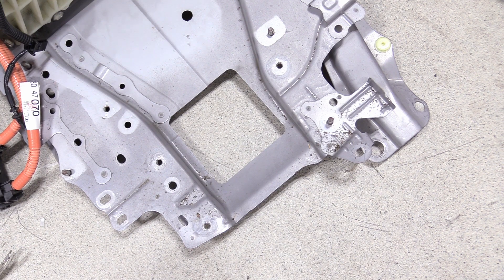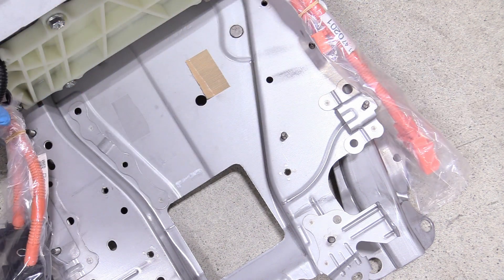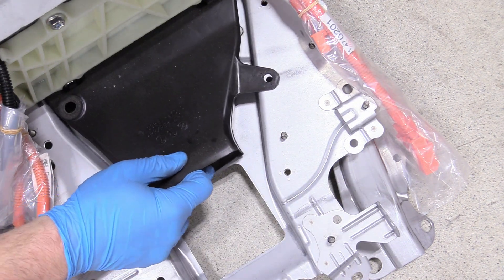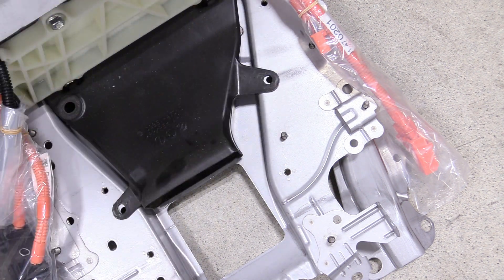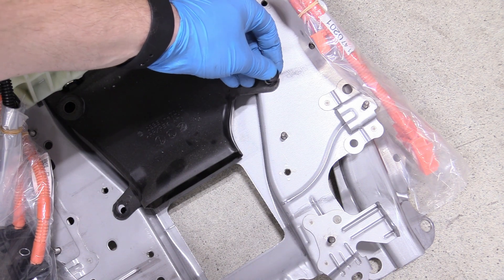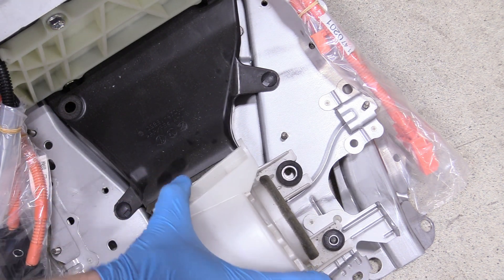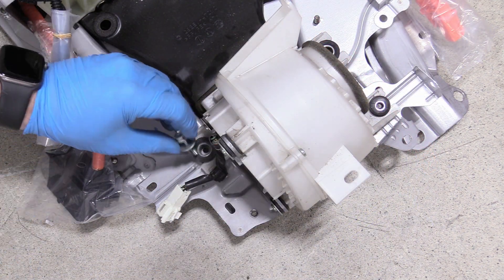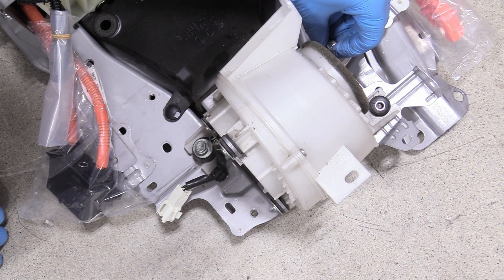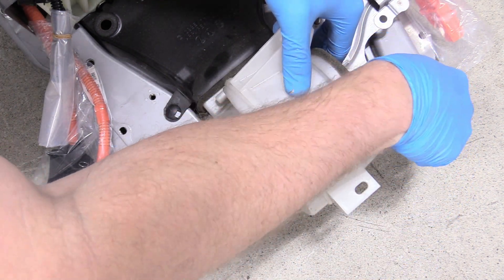All of the battery has been disassembled. This one is ready to go back to Toyota so they can hopefully rebuild it and put it in another car. Assembly is the reverse of disassembly. Get that tape off of there, then we can slide in our new ducting. Our battery did actually come with new body clips, so I'm going to put those in — because sometimes they're reusable but a lot of the time they break, and since I have brand new ones I'm going to use them. We can put our fan back in, line it up with the bolt holes, and start all of those by hand.